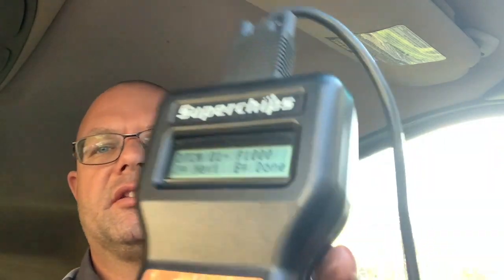All good and secure. We're back in the truck and I've got the handheld plugged in. Going to diagnostics to read the codes. All right — no codes, well P1000. We'll clear the codes and read again. All we have is the P1000. P1000 means that there isn't enough information for the computer to determine whether there's any issues because the codes have been cleared and the vehicle has not been started or driven.